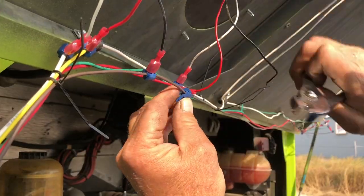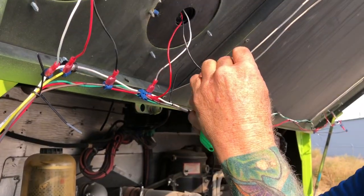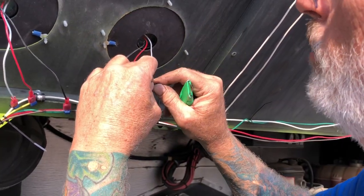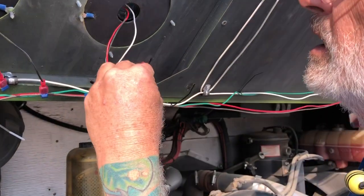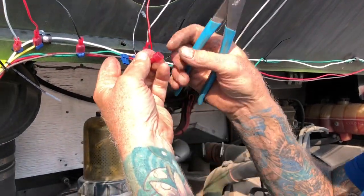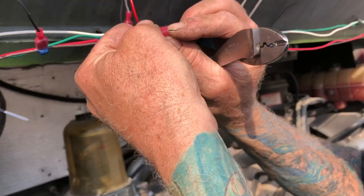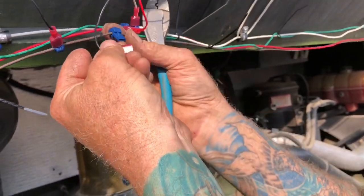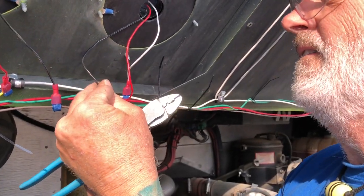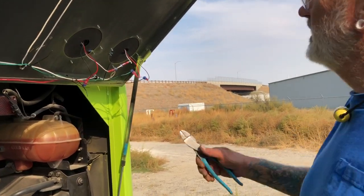Get those on like that, then strip these off farther, fold them back in half, crimp them on, and make sure that your tongue in there doesn't fold because when you go to plug it in it'll miss the middle. You've got to make sure that thing is right in the middle - we learned that the hard way inside! Why, you're making progress aren't you!